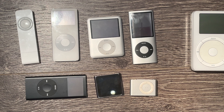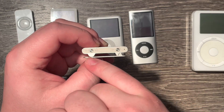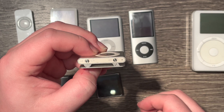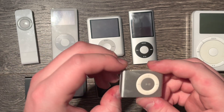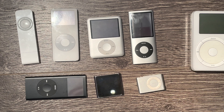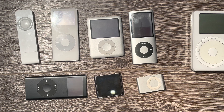With iPod shuffles, I've noticed that the second generation iPod shuffle tends to expand more than the first generation. You can tell because the casing gets bulgy, the buttons get very hard to click, and your iPod gets very warm when charging. When you charge one of these, I highly recommend using the original charger that came with it. If you don't have it, try to buy one, because using a third-party charger may risk damaging the battery through incorrect current transfer.